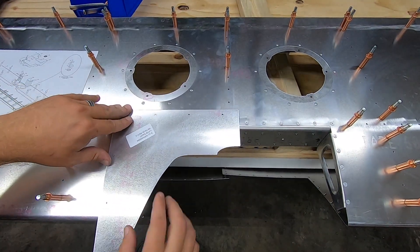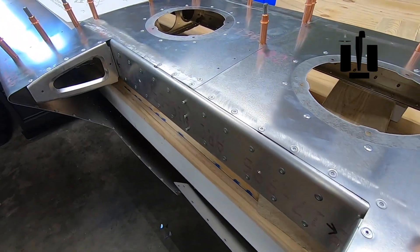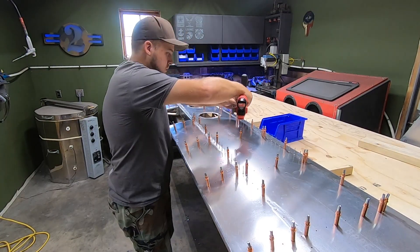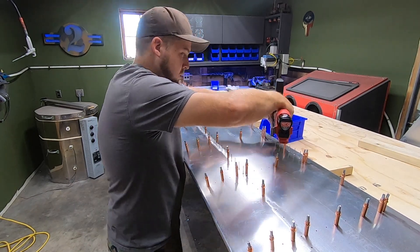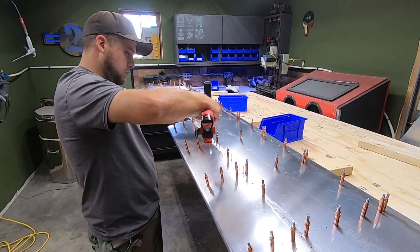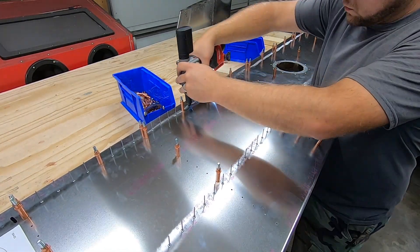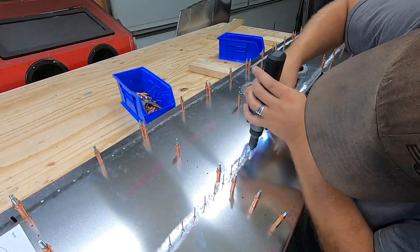This is half the fairing that will one day be installed over this area. The flush rivets allow it to sit nicely on the horizontal stab surface. Holes and nut plates will be added at a later date to secure this fairing once everything is in place on the fuselage. There isn't much more repetitive than shooting a thousand rivets, so I apologize for all the sped-up footage, but I felt it was important to show the sequence I chose to take on this project — right or wrong, I hope it's useful to someone out there one day, even if it's an example of what not to do. Time will be the judge.